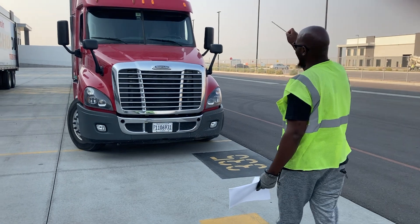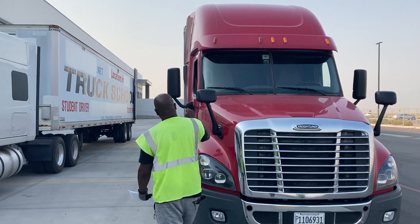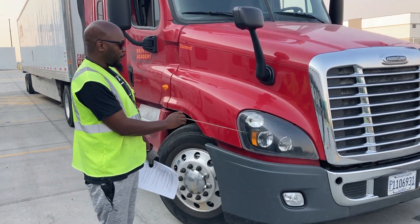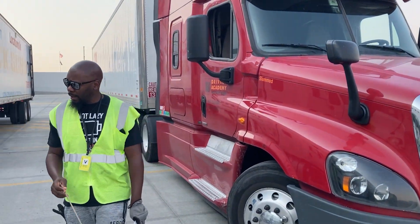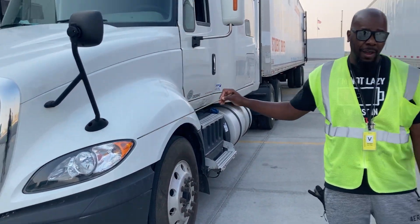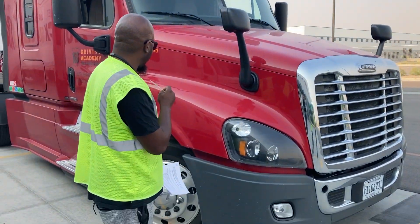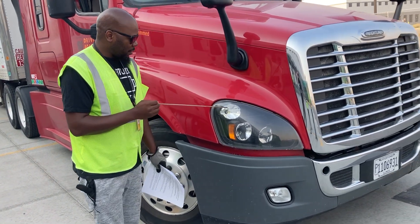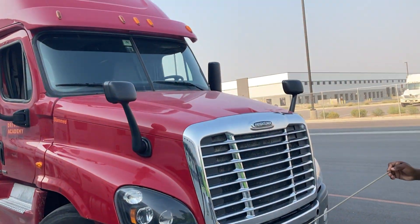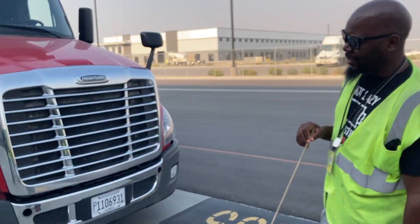Coming to my lights: I have my clearance lights at the top, my side marker, my side signal, and my turn signal indicator. We now have to call out this reflector, particularly on the Freightliner — on the International, that reflector is in a different location, but we still have to call it out. That is now part of the new test. My clearance lights, side signal, side marker, turn signal, and reflector are all amber in color. They are properly mounted with screws, present and tight. None of my fixtures are cracked, broken, have holes, or condensation.